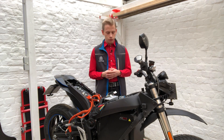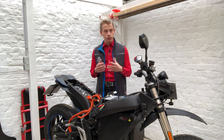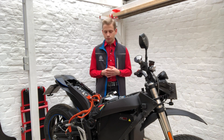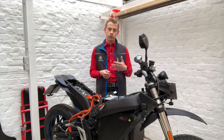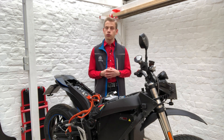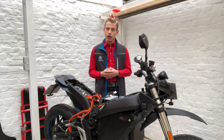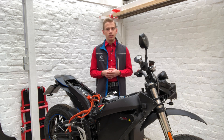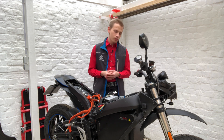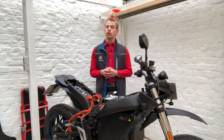Last year I suffered from a lack of 12 volt supply. First I thought maybe it's a fuse, maybe it's a bad connection, but that wasn't the case. The cuts of the 12 volt system were unexpected, so after some investigation and research on the official Zero Motorcycles forum and a look into the Zero manual, I came to the conclusion that it might be a faulty DC to DC converter. I checked it, I measured it, and indeed my DC to DC converter had failed. So today's video will be about what the problem is and how we can fix it.